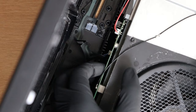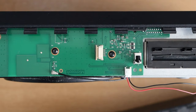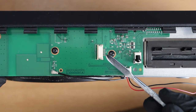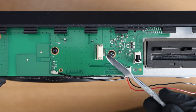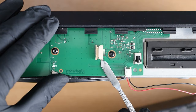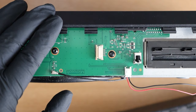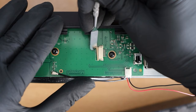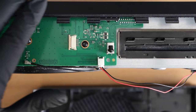So first things first, this is what it looked like with the cable in - you had the cable that went in and then the blue around the outskirts. To remove the cable, you need to gently, with your prying tool, push the two sides of the button. This will loosen the ribbon cable. Then take up the blue that's around the ribbon cable and that will loosen it off the connector. You can then just pull it out - it's real simple. Same rules apply for putting it back in: you put the ribbon cable in, loop the blue around, and then push either side of the plastic in to secure the cable.